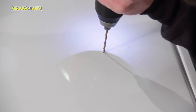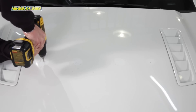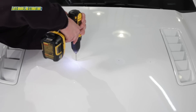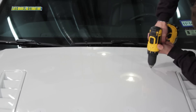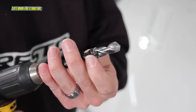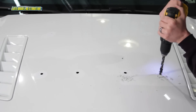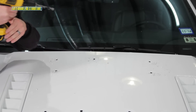Using an eighth-inch drill bit, drill a straight centered pilot hole through the second layer of sheet metal on the forward outer holes. Drill nine pilot holes total — four along the front, three along the back, and two, one on each side. Using either a step drill bit or a 7/16-inch standard drill bit, begin drilling the pilot holes open. Do not drill through the second layer of sheet metal with the 7/16 bit.